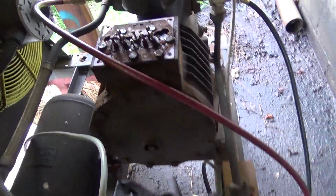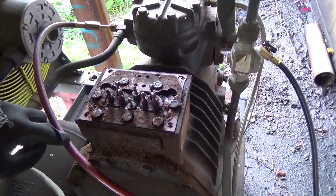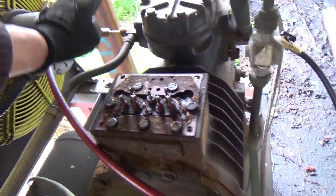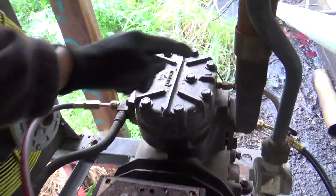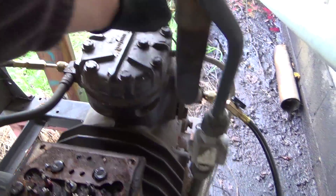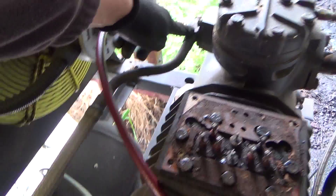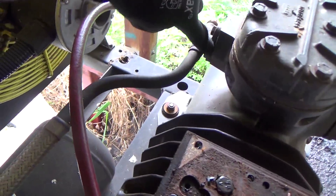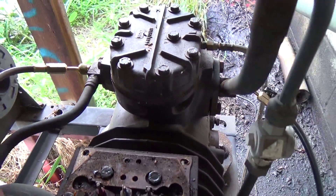Right, back again. I've got a rebuilt compressor. I've got the electrics disconnected, I've got the gas took out of the compressor, the valve shut off. So it's just a case of undoing the pressure switch connections, undoing the valves, four mounting bolts and then lifting it off. It's always worth brushing around as you need to get rid of the dirt — you don't want any dust or anything getting in there when you take them apart.